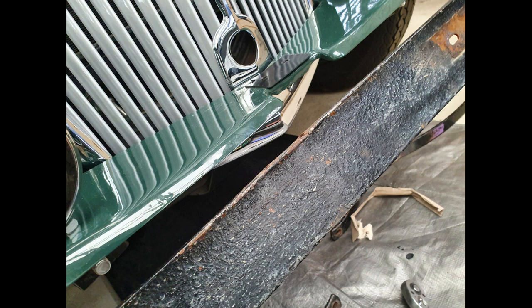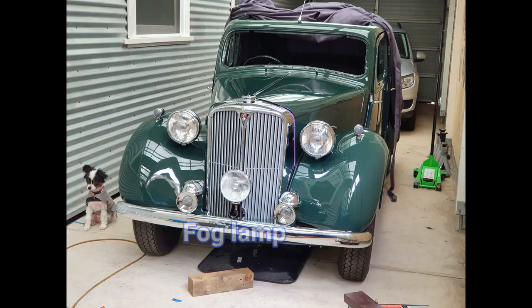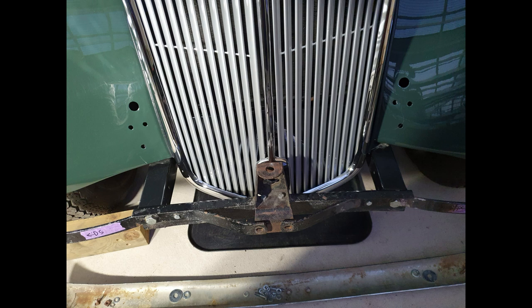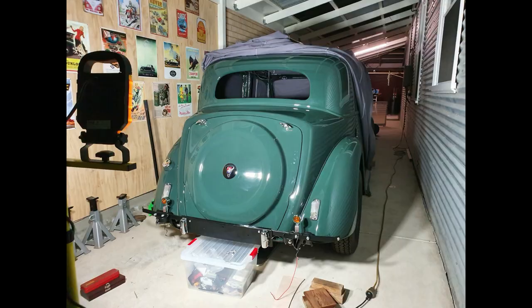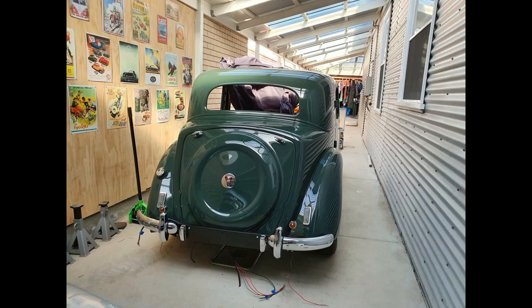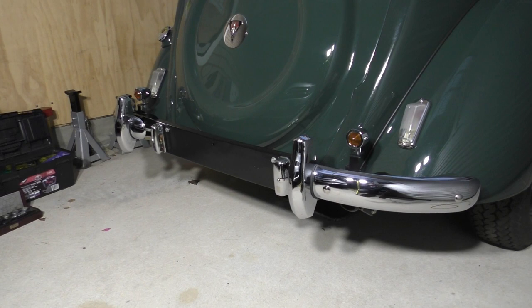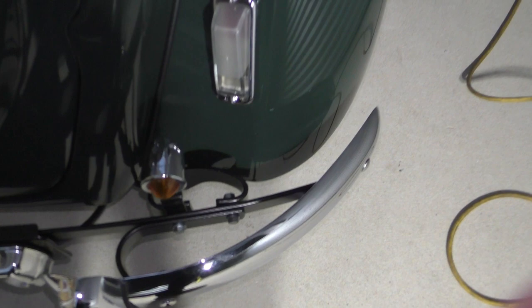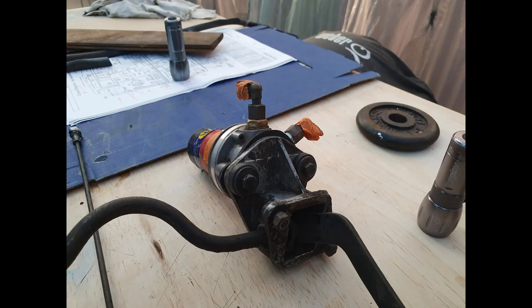My next trick was to get the brackets and number plate supports ready for powder coating. I had to do a bit of weld repair first, but otherwise it wasn't in too bad a shape. The heavy bracket in the middle supports the fog lamp, but there were a couple of little spacers missing that sit in front of it which I had to make. I turned them up from stainless steel. Once the brackets came back from the powder coaters I had my first go at refitting them, aiming to get the bumper sections sitting equally distant from the guards on both sides, sitting level, and equally distant from the number plate bracket. I was pretty happy with the end result.